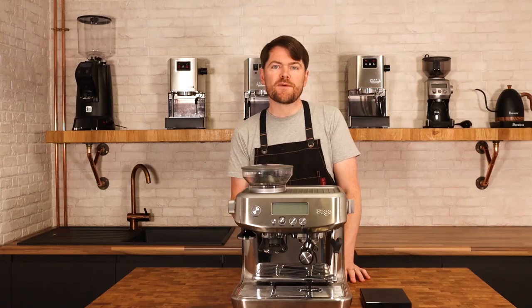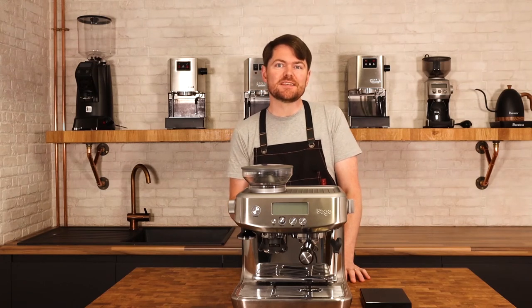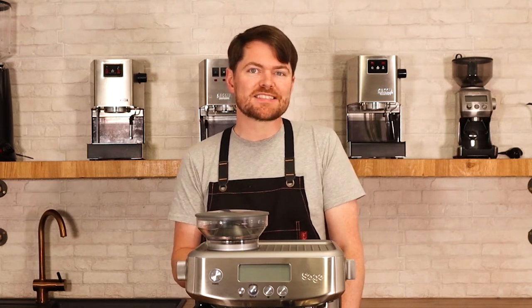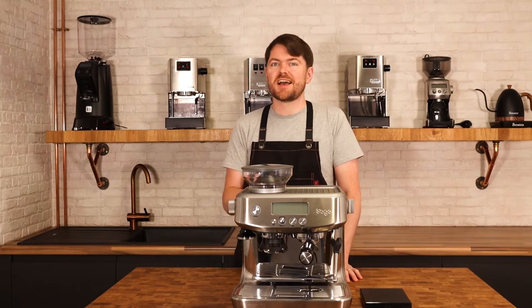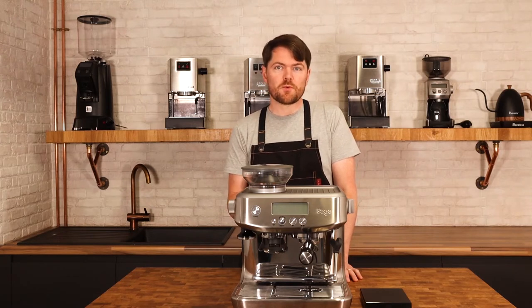With the Barista Express and Barista Pro we have internal grind adjustment on the burrs as well as the external adjustment by the dial. They come factory set to the inner setting of six, but what I find is that at this setting I'm not quite at a choking point at grind size one — the finest setting. And that means that you don't have much range down at the finer side of things. So if we change the internal grind settings just slightly so that we're close to choking the machine at grind size one, we're then set up for grinding finer for espresso with standard baskets.